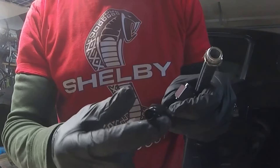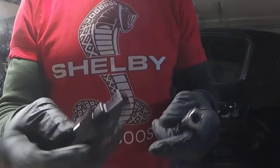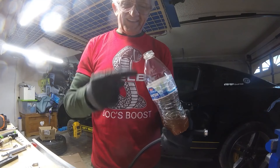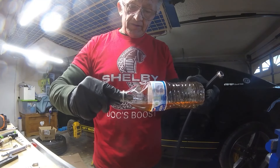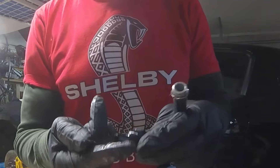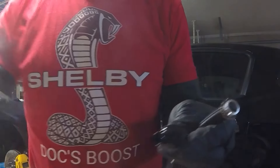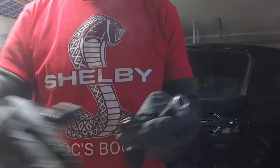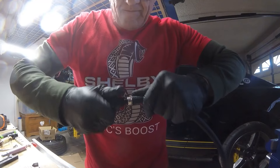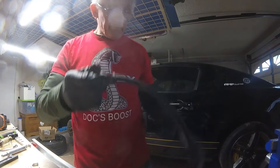We're going to coat a little bit of oil around this edge so it pushes in really easy. If you don't put the oil on there, it's going to fight you to the death — I guarantee it. Brand new supercharger oil. Get a little bit on your glove and put just a little bit on there. You don't need a whole lot — you can see it got shiny and there's a little bit on there. Then it shoves in there pretty darn easy. You can feel it go past the ribs and it's home — you can see there's no gap and it went in pretty easy.